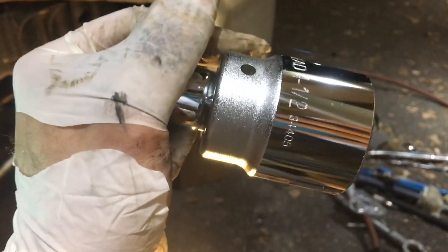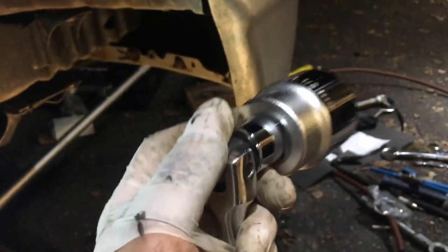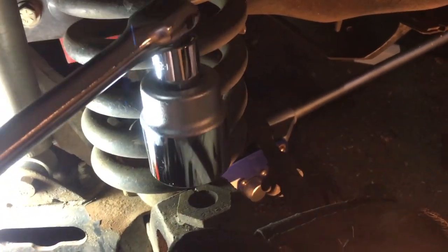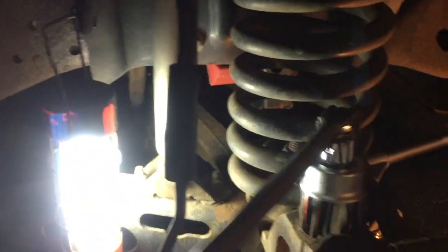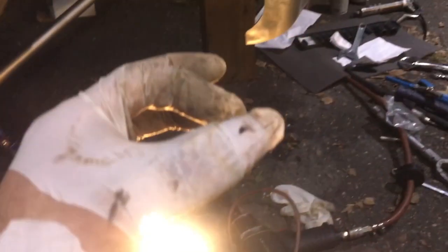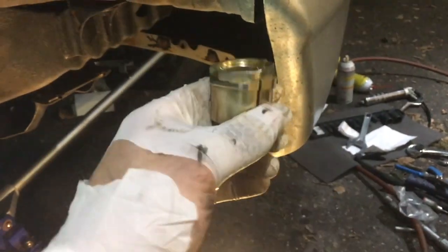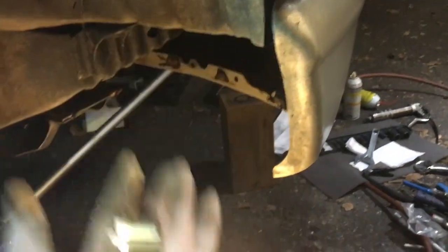To make life easier for doing your camber nut, you're going to want to pick up a one-and-a-half inch socket and a reducer down to half-inch because this thing is huge. Basically what I did is: tons of penetrating blaster, some heat from my MAP gas, and I took the socket and just kept spinning it back and forth and prying a little bit with a pry bar. Eventually it came out, but you have to keep spinning it because the pry bar wants to lift unevenly on one side — it comes out sideways and stops. So just keep twisting and lifting and eventually it should pop right out.